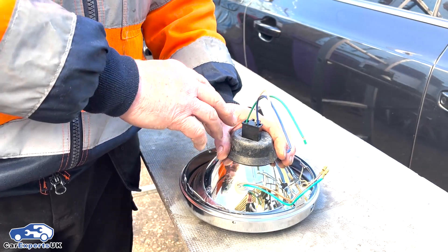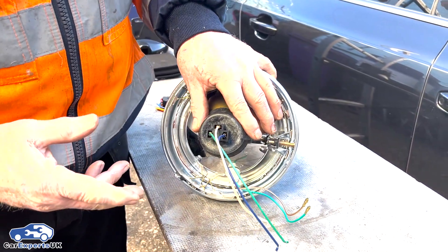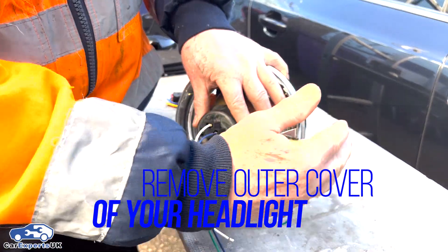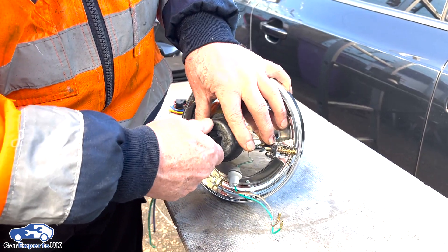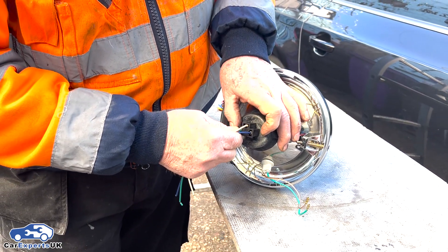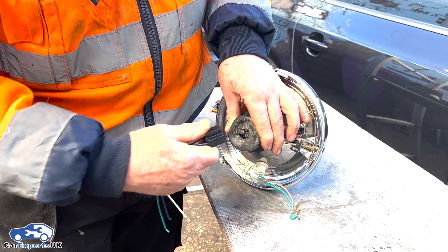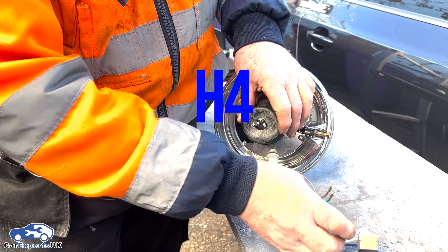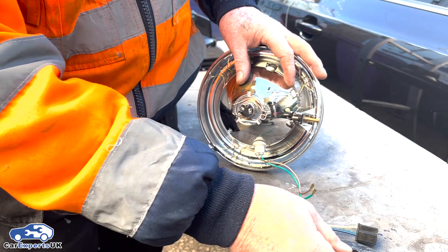How to take the bulb out and put a new bulb in. We've done it like this just to make it easy so you can see it. First of all, you need to remove the outer cover of your headlight and then you'll be able to see the plug. The bulbs will always be tight on the plug, so you need to wiggle the plug slowly and take it off. That's a H4 which is three pin. And you might have a rubber cover which you can then take off.